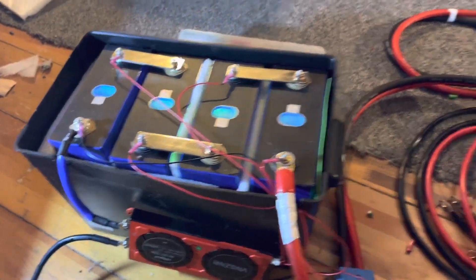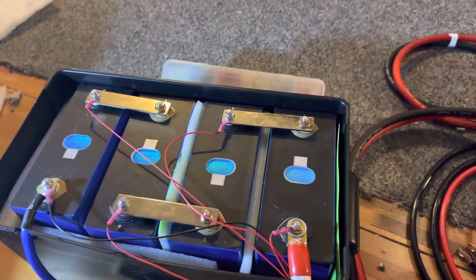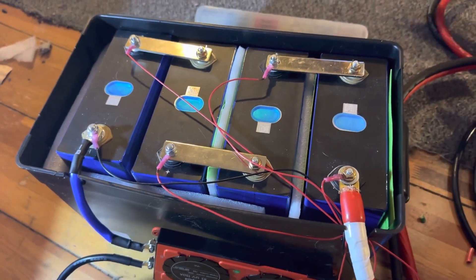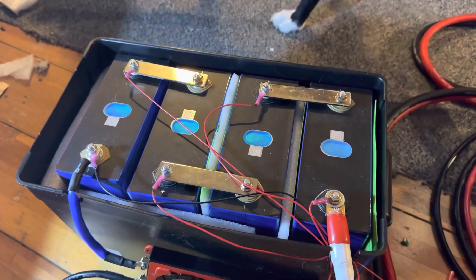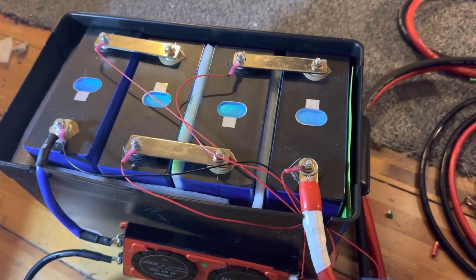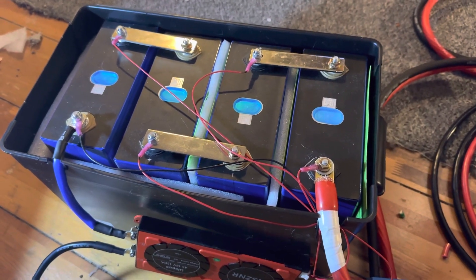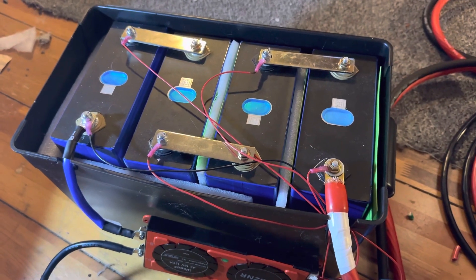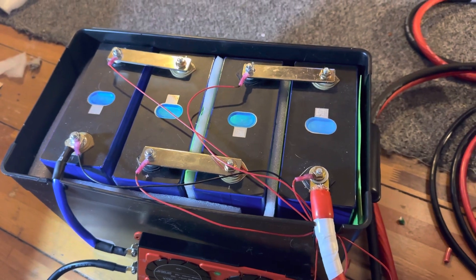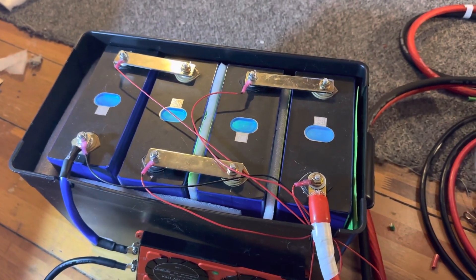I built this all today. Now, 280 amp hours of lithium power — if you had a truck, say a Ford F-150, with a heavy duty battery in it, that battery would be probably around 90 to 100 amp hours. So this would be equal to almost three heavy duty batteries, or three RV grade batteries. That's how much you get out of lithium.